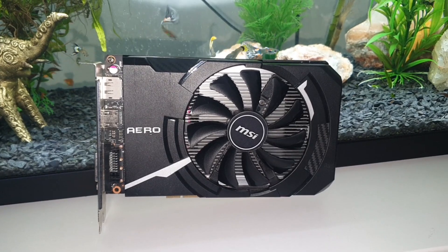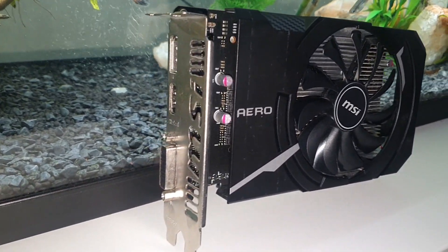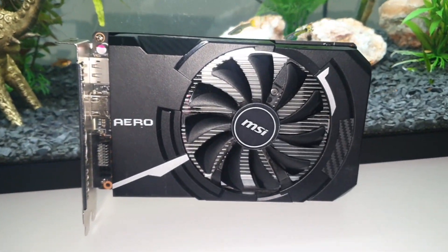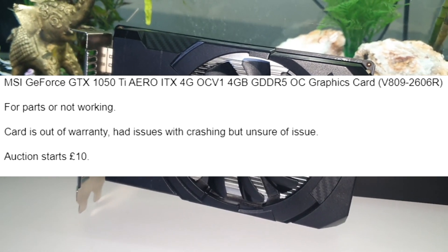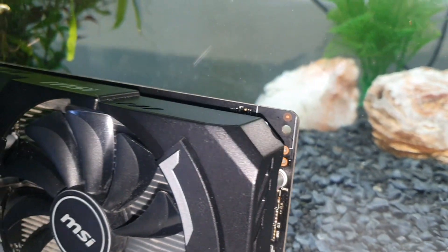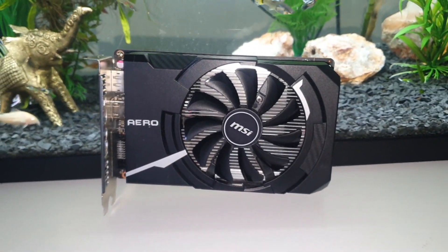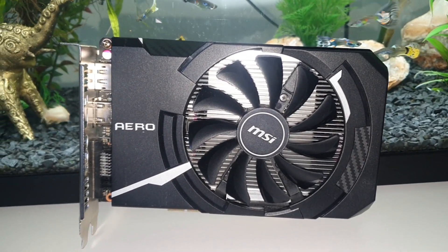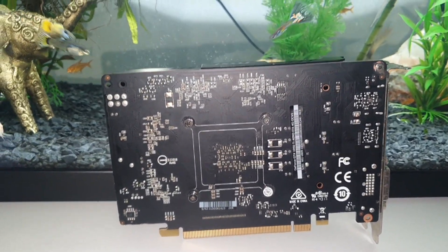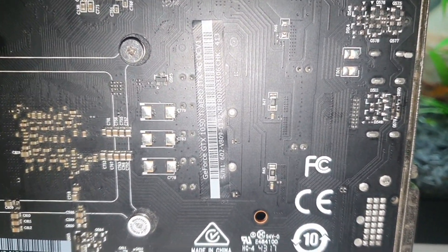I then bought the GTX 1050 Ti from eBay. As I was scouring eBay for bargains — I also buy locally and from CEX, I pretty much shop everywhere — I noticed a GTX 1050 Ti listing on eBay listed as spares or repairs. In the description the seller mentioned it's just crashing in games, so it wasn't artifacting and it was booting into Windows. I decided this was probably just a faulty or outdated driver, which I've seen many times. I took my chances, paid £52, it arrived three days later, and with the newest driver installed and a clean, it worked without any issues whatsoever. I managed to get a GTX 1050 Ti for £52.